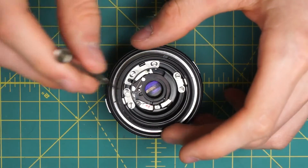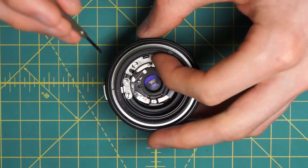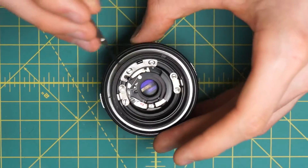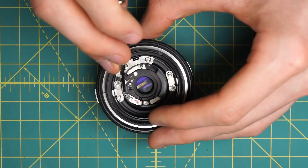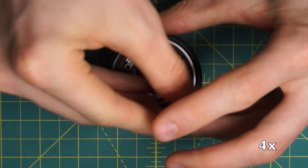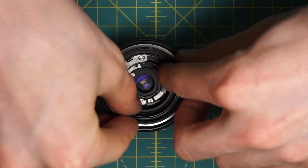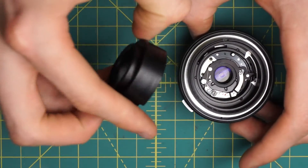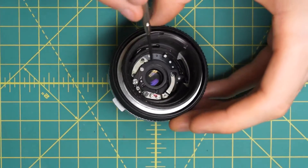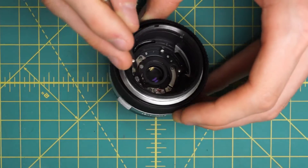So I'm going to undo this top ring and expose a few more of the mechanical pieces on the next level. It's just held in place by these two couplers that go from the inside here to the outside — these two metal bars. So I'm going to undo both of these bars; they have two screws on either side. Remove both bars and I'll be able to lift out this center first piece. Now I can just grab this top piece, lift that out, and set that aside. Now I have access to the front of the mechanical sections in here, so if there are any mechanical problems, you could fairly easily repair those at this stage.